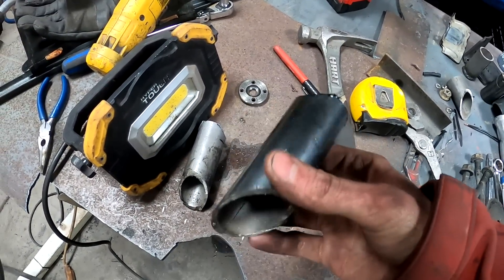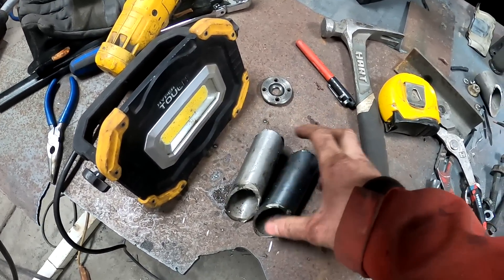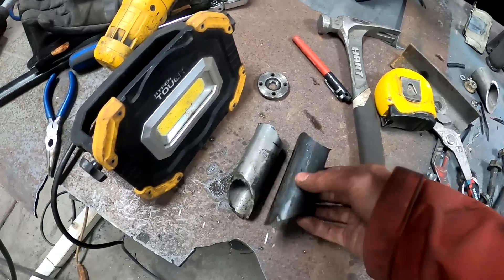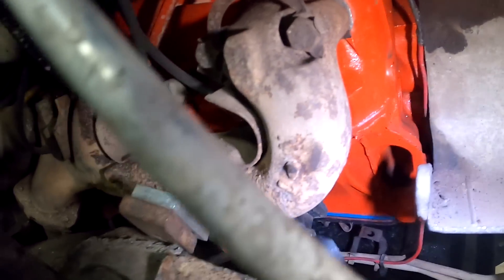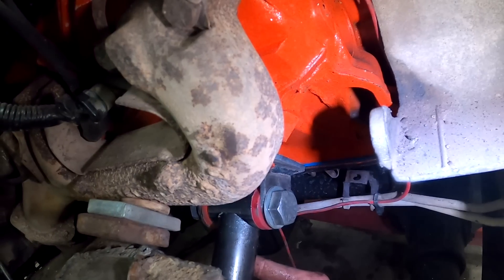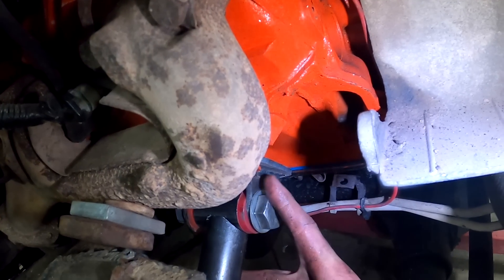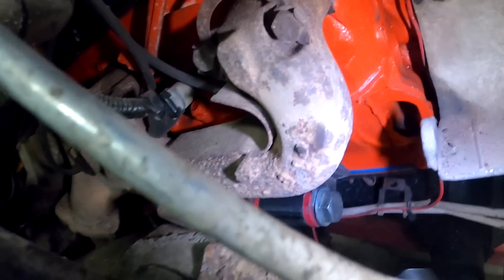Here are the little things I made — this side gets welded to the frame, this side gets welded to the mount. I notched them out. They're both the same material but different brands, which is why they look slightly different. I got the motor placed in with a couple of shims where it needs to be. You can see where it's notched — it fits right on there and goes right to the frame. I'm going to weld it to the frame, tack it here, then pull the mount off, pull the rubber out, fully weld it, and put it back together.